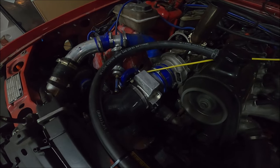Normally you'd think, oh, well, maybe it's placebo, because obviously that sort of thing is hard to tell. But no, the reason you can tell on this is because the lag was so bad for the gearing before. Before, changing up at, say, 6,500 RPM, you drop down to about 5, which is well within the boost threshold, but it would still drop off boost, and you would have what felt like a couple of seconds, but I don't know how long it really was, but quite a while before it went back up to full boost. With this new setup, I can change up at 6.5, and it's literally 2 bars straight away. Pretty much no lag. No lag in turbo car terms, anyway, unlike how it was.